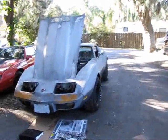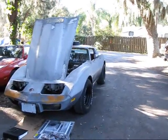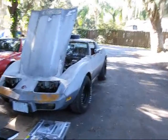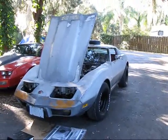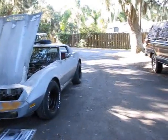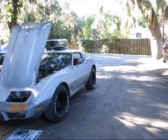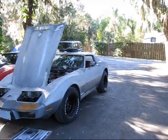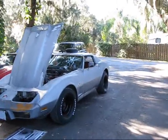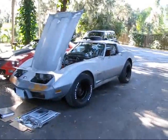This is another clip of the '76 Vette running. Yesterday I changed the oil — put synthetic in it with a new filter — and also put a new cap and rotor on it. That made the engine sound tons better; there was a noticeable improvement in the smoothness of the idle. The old cap and rotor were probably just corroded, so they helped out a lot.